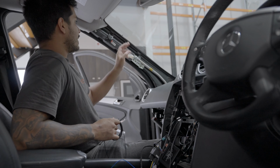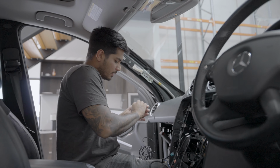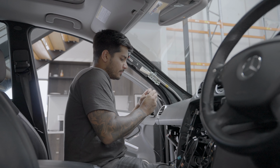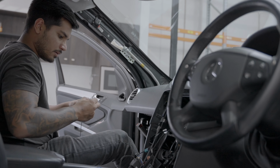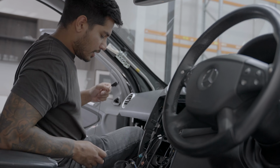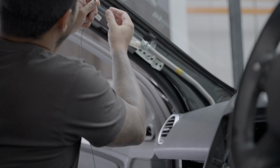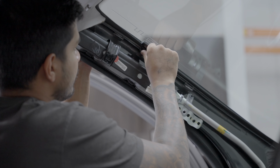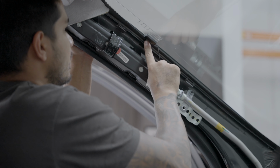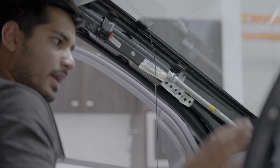We've stuck on the DAB antenna little sticker, so now we're just gonna chuck the antenna on. So that's pretty easy. Just got some double-sided on it. All right, once you spend 10 years getting the double-sided tape off, you're gonna go that way. Okay, it's got a little pin on it. The pin touches the metal, and then you just run this black part over, and then it grounds right there. Beautiful. And then this will tape up and run to the head unit.